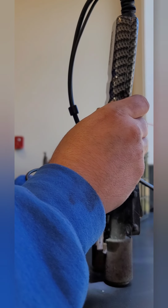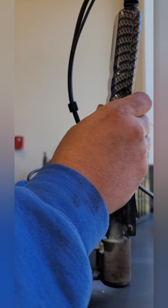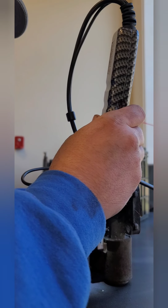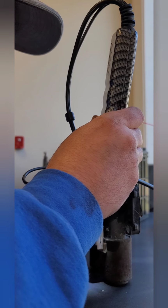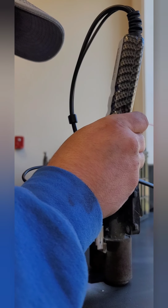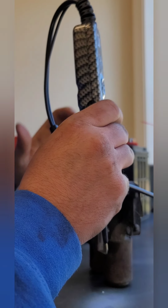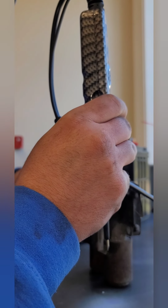So you can hear that click, and it's a good strong click. Now you don't want to sit here and hold voltage to this because you don't want to burn it up. So just set a little power so you hear it click and let off. If you use alligator clips, you can just tap it and you'll hear it.